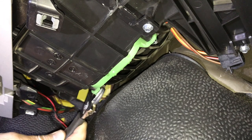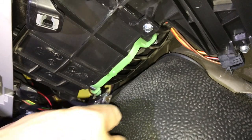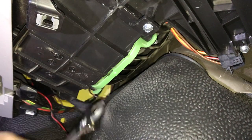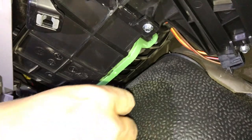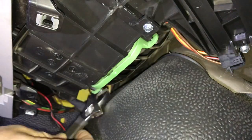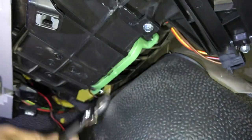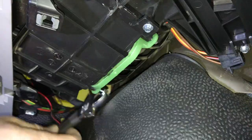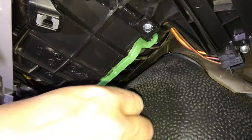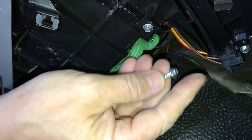The old adjustable spanner — you can knock them but you can't beat them for those times. It's a really odd-ball size, 5.5 millimeters. I must invest in a 5.5mm spanner because this is the first of these T6s — they've actually changed these heater resistors, so this is going to be something that comes up in abundance. These threads are quite a coarse self-tapping thread so they don't take much getting out.